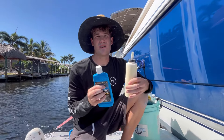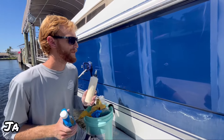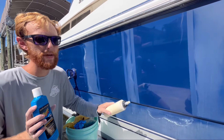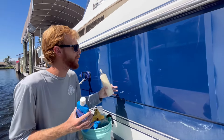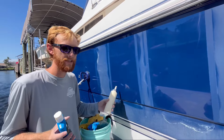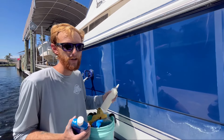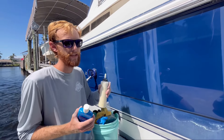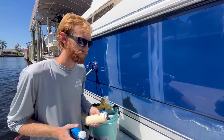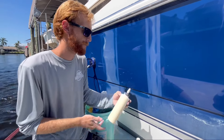I don't think you're going to have an advantage going with one over another for oxidation — that's just my take. Jacob had a similar view: the Meguiar's Oxidation Remover left a little heavier swirl behind while still cutting a similar amount to Level R. If you can leave a nicer finish while cutting the same amount of oxidation, Level R would be the choice. And if we test them on 1000-grit sanding scratches, Level R would likely take the cake because of its different workability. It was more formulated for scratch removal from sanding.